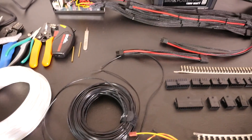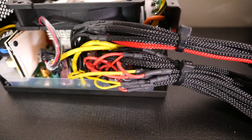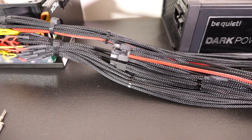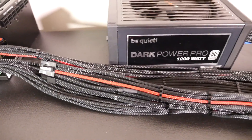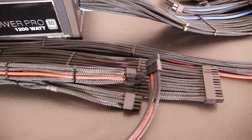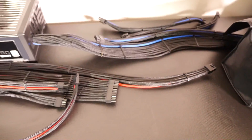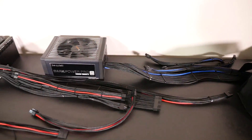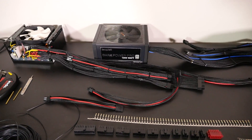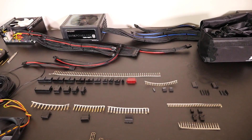The other thing you can do is reorganize pin-outs, because pin-outs are usually an absolute mess — this is a great example of how terrible they can be. You can actually go through and clean them up, remove unnecessary split wires, and all sorts of things if you're bold enough and know enough about it. This is something I'll get into in later videos because it's a more advanced aspect of custom wiring, but it's just another upgrade you can do.